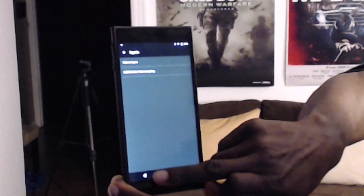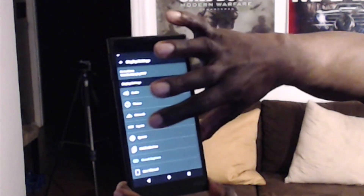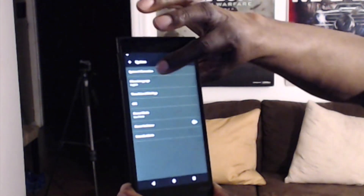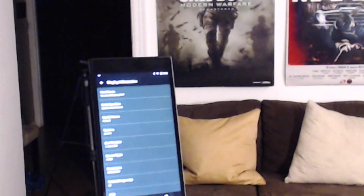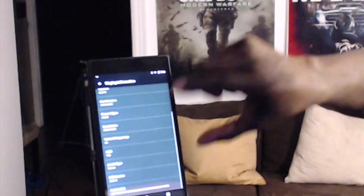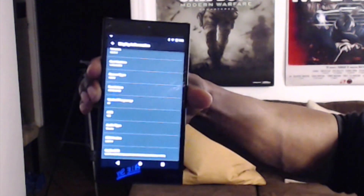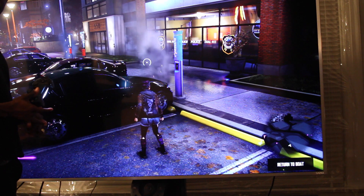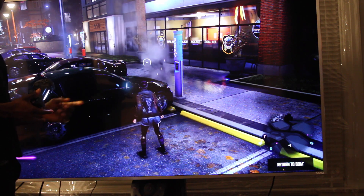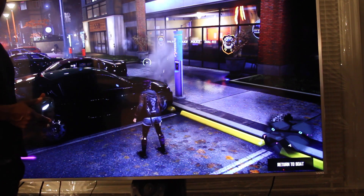Now we're going to find out if the HDR is registering. We're going to go to systems, system information, display information — that's meaning whatever's coming out of HDMI port 1. And if you scroll down — voila — right here, if you can make it out on the camera, it says HDR: yes. So we are golden. That's all it is. Make sure you plug the HDMI cable into the HDMI input 1 ARC slot on the Vizio P65-C1, and your HDR dreams will come through and it will say supported.